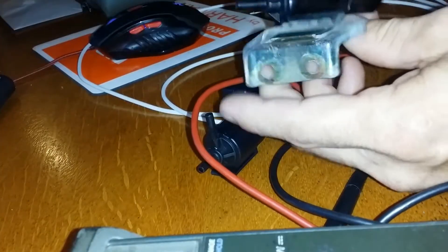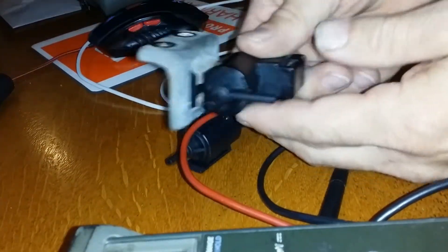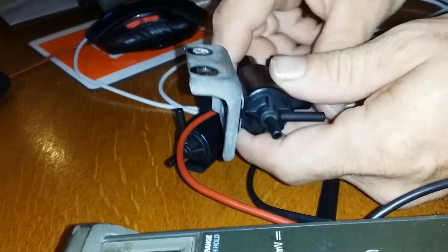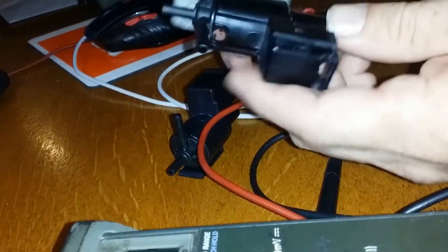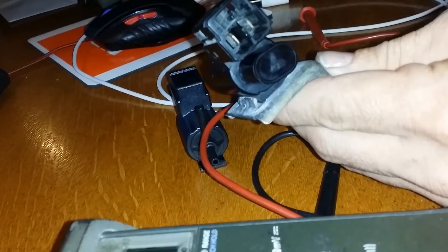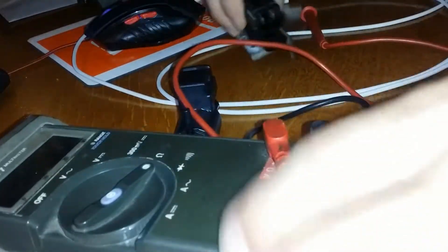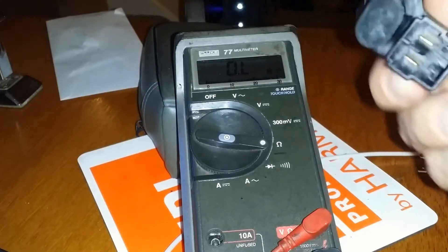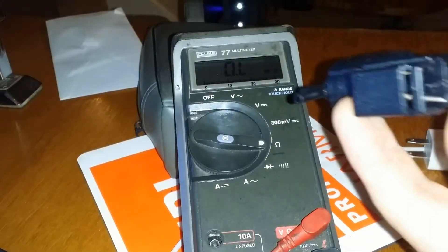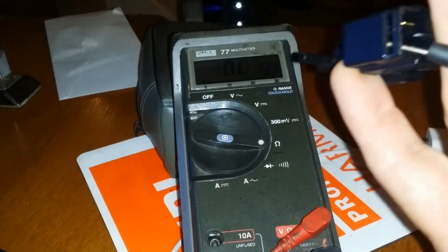Here is the valve mounted in the car, in that orientation where the two bolts attach to it. This is the valve — two connectors inside. So basically the first test is you test the resistance across those two terminals.